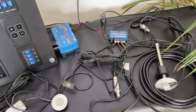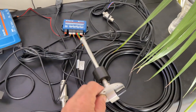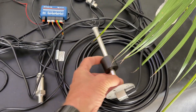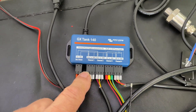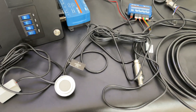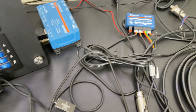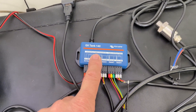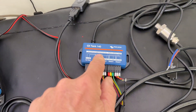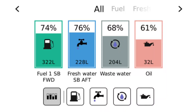Hi, Bruce from Safari. You'd all be familiar with the Victron tank display, and up until now Victron have used resistance type sensors — this is just one example. But with their new product, the GX Tank 140, we can now add in voltage based sensors. I've got four different voltage based sensors on the table, used primarily for tanks, and we have a USB extension cable so this is currently 12 meters away from the Cerbo. This display will be released in the next software update.